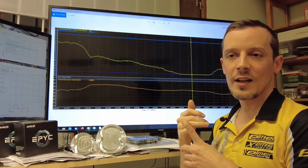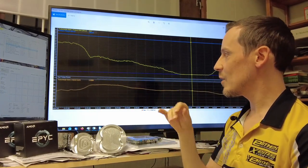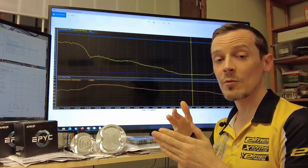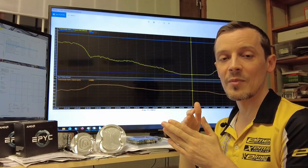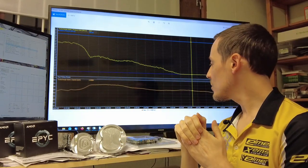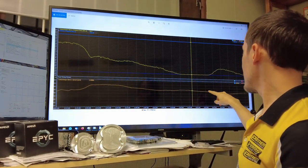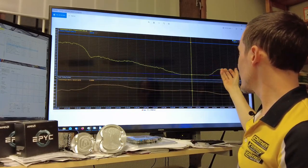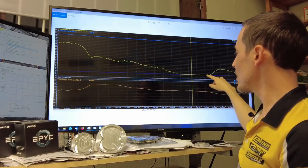Clearly there's either boost pressure control — which is kind of difficult to do with this type of choke limit — so you'd really want to do a turbocharger RPM-based target map for this. Adjusting this correctly, you can keep the flow amount high enough so that you're actually on the choke limit all the time.